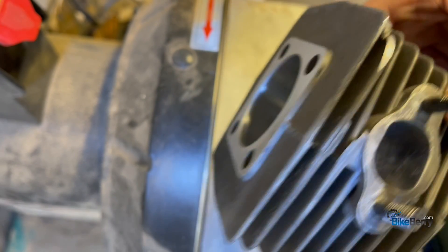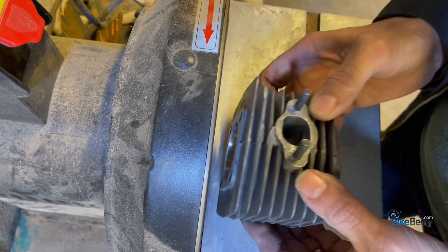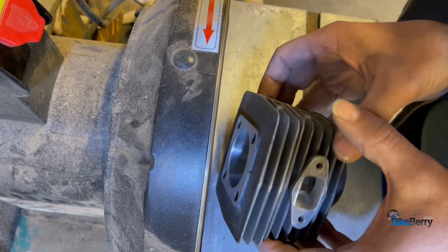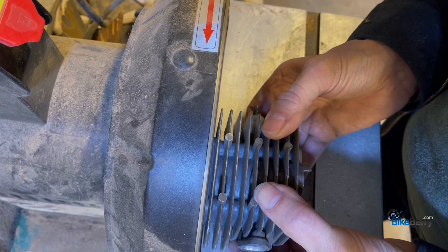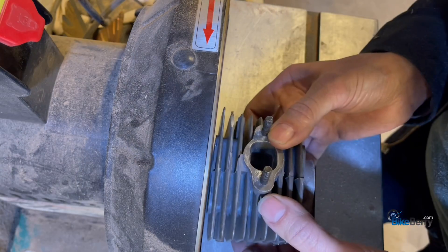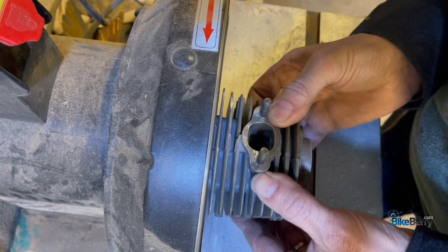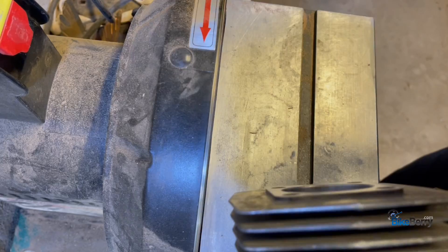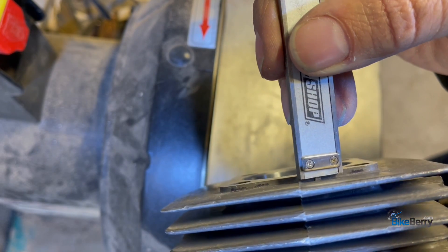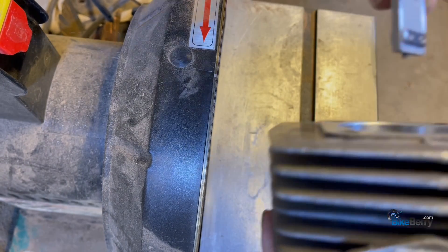See the marks on the corners? We're getting close. Stop and keep checking it, look at your marks, continue where you need to. On my cylinder head, 1.65 millimeters is what I'm going to have protruding past the fins. When I strike that measurement, that's going to be my gauge to check it once I get down to those marks really close. I still have a ways to go, so let's finish it out.